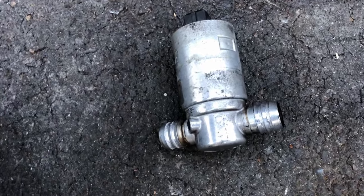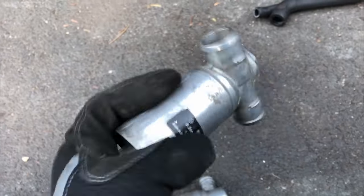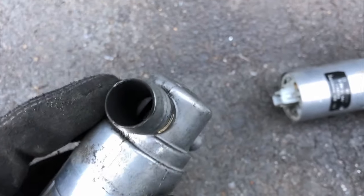I just got back from class. While I still have a little bit of daylight left, I want to get some parts cleaned that I'm going to be putting back in the BMW — specifically the intake manifold. I want to clean my idle control valve too. You can just see on the inside of this intake manifold there's just tons and tons of carbon buildup. I figure with this engine I need as much airflow as I can get. My idle had been a little bit rough, and the idle control valve — you're supposed to be able to hear a little bit of clicking — this one just does not want to do anything, and there's a bunch of carbon buildup in there too.